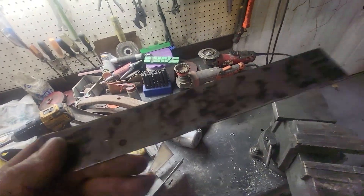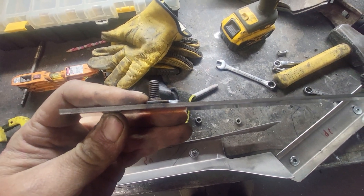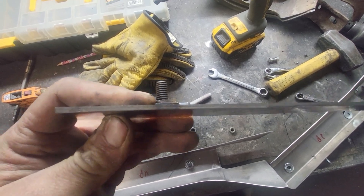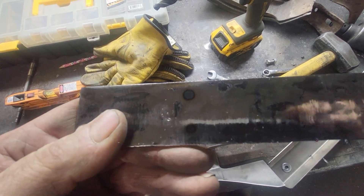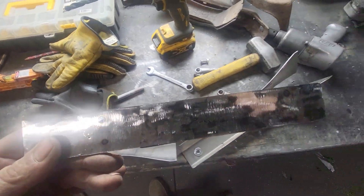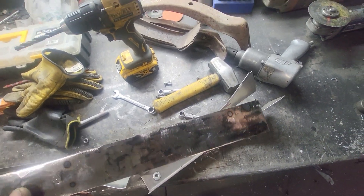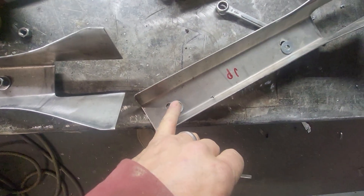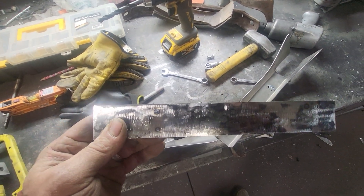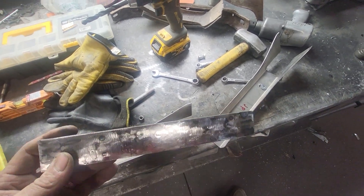Basically what I did was I threaded — this is a piece of 10 gauge. I built them in pairs, built them together, drilled, identified my drill holes on the center with these, kept them clamped, and then threaded the works together, sandwiched together.